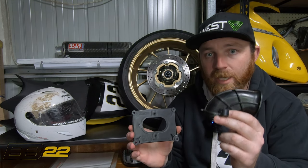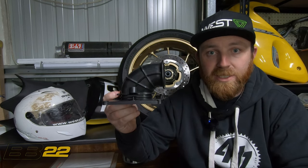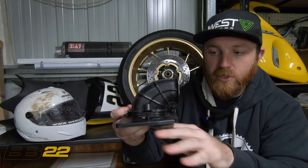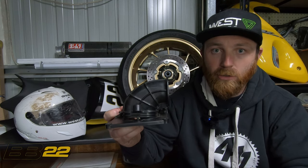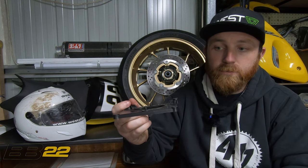The next question is: why do people swear that removing the snorkel gains bulk power? With the R7 and 2021-plus MT07s, the snorkel and lid sit flush together. With the older MT07 and the FZ07, the snorkel actually protruded down into the airbox causing more restriction. With the R7 and modern MT07, Yamaha changed that, so you don't get as large a change — the result isn't quite as large compared to earlier model bikes. That's why everyone used to scream about it.